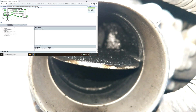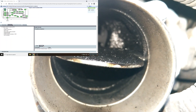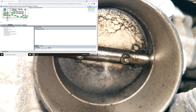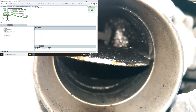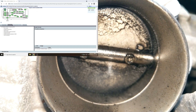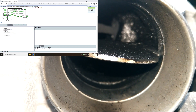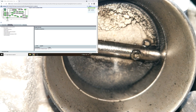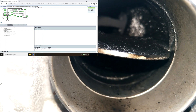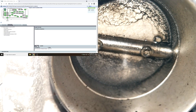I was able to use the Volvo software Vida, which basically allows you to interact with various components and activate them. As you can see from me doing the open and closed activation on Vida, you can see that although it's slightly coked up and it's got some carbon on it, the throttle opens fully, closes fully, there's no dragging, there's no sticking, it doesn't stop halfway — it's a very nice, snappy action.